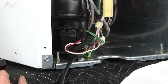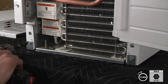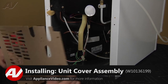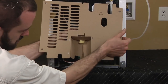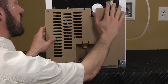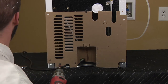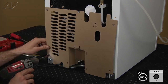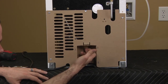Now we're going to go ahead and go to the front of the unit and reinstall the two 5/16 screws that mount the cabinet to the base. Now we can go ahead and reinstall the back panel. To reinstall the back panel, start by putting the drain hose up through the opening. Make sure your power cord is in this gap and your water line is in this gap here, and reinstall the five quarter inch screws. Now reconnect whatever drain line you have to your actual drain line on the ice maker.